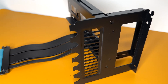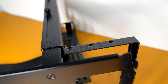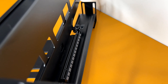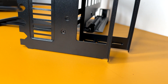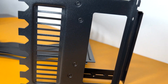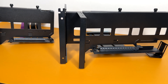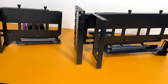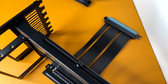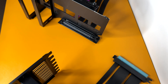That's all for this video. As a concept, installing a GPU vertically is a nice thing to do — it might help get better temperatures and prevent fans from being loud. You should also consider if there's enough clearance between the side panel and the GPU fans, and between the motherboard and the GPU back plate. There are plenty of cables and brackets available, and some offer this sliding mechanism which I prefer for flexibility and better cable management.